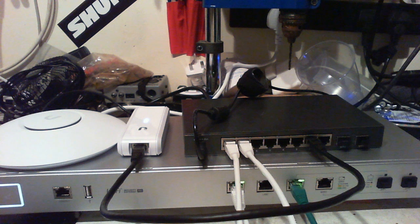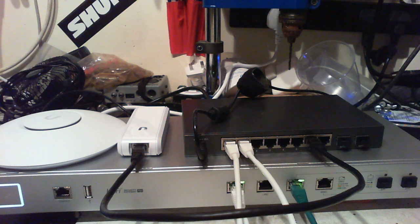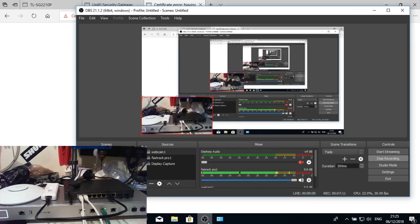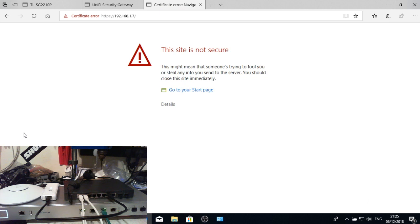I'm going to do a fresh install of their Unifi controller rather than backing up and migrating, because their network is going to be completely different after the upgrade. At the moment they have one subnet with everything on it, and we're going to change that. The Unifi Cloud Key has booted up — it sometimes comes up on 192.168.1.20 and we have DHCP enabled on the USG Pro.